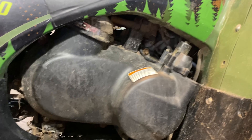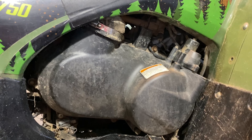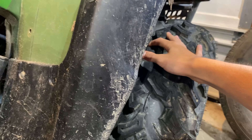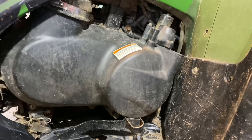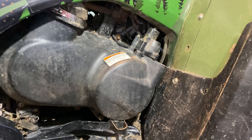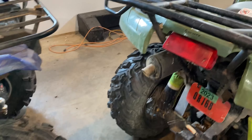While we're on this side of the bike, the clutches are stock but the clutching is not — the weights and everything have been changed. It's clutched for 28-inch tires, which is what we're running. I do want to run 28-inch mud tires eventually and it'll do fine. I'm not sure of the brand since the previous owner never told me.